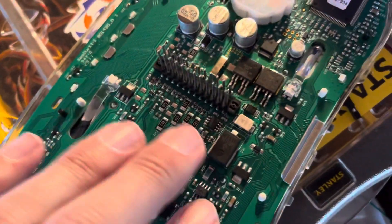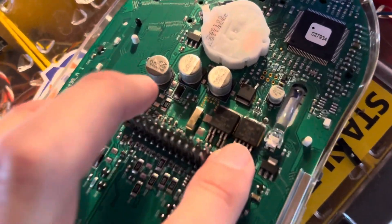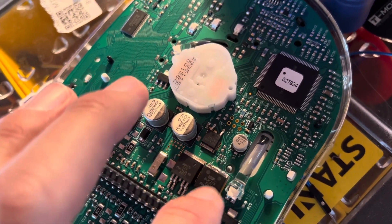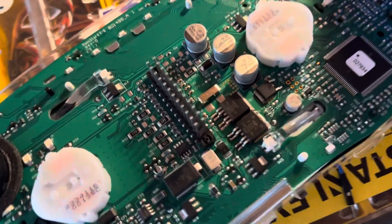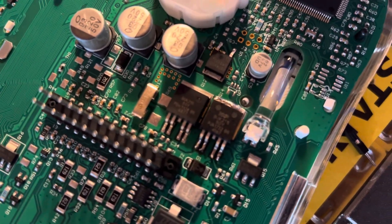So I took this out of the snowmobile and decased it, and it was immediately apparent that this chip right here was raised — it was swollen and burnt looking. I've already replaced it, but it's a really easy job if you know what to look for.